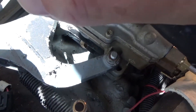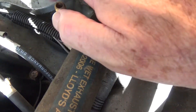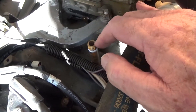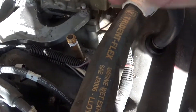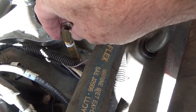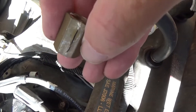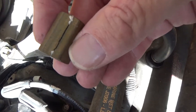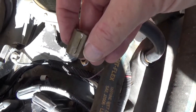Okay, so anyways we're trying to look for a vacuum problem. Now both engines have vacuum gauges on them. This is where this vacuum gauge was, and when we ran the engine it was running pretty poorly. But I tightened this up a little bit and noticed this black line — when I took a closer look at it, it's actually cracked. This fitting here is cracked, so not good.